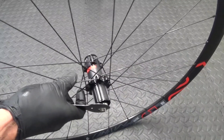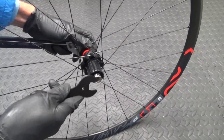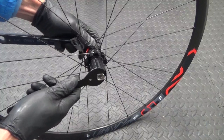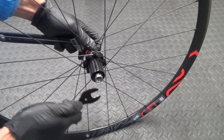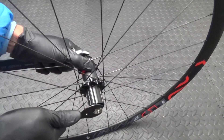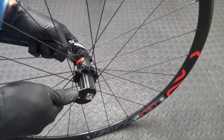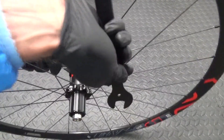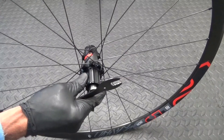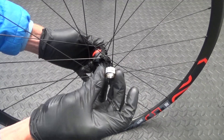What you want to do is hold this side, and then this nut here is opposite thread — so you'd normally be undoing it anti-clockwise, but to undo this you go clockwise. So you want to hold on to both sides like that. Make sure your spanner is on that side. So it's anti-clockwise — pull up on this side. Once you've broken it loose it will just come undone, so you can take your adjustable off the other side. It's clockwise, just keep threading it off and the nut will come off.